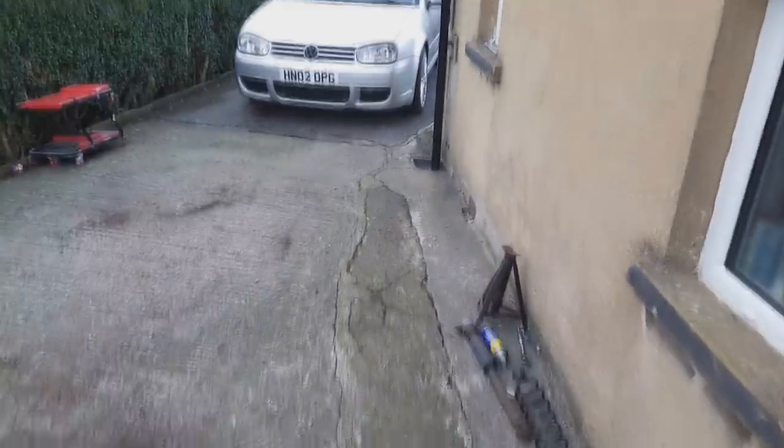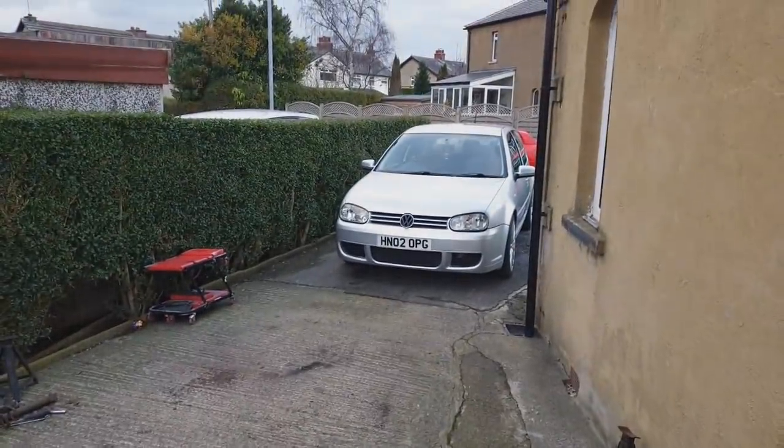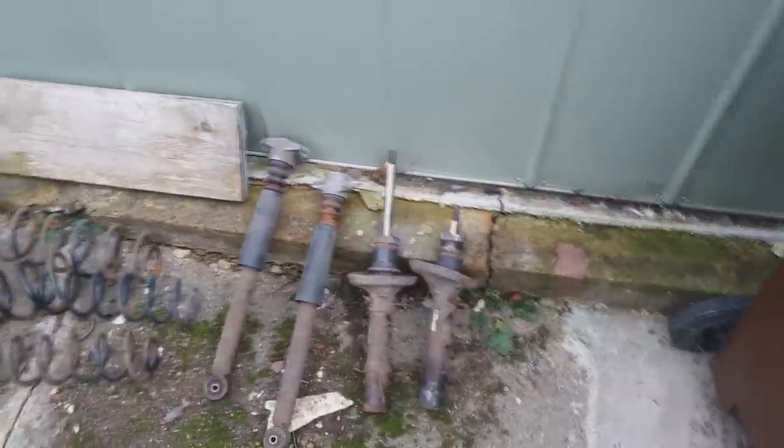I've done one rear side — now I'm naked and cold with the other side still to do. Here's the crap I took off. The rear dampers press and come out on their own — not too bad. The front damper though squashes quite easily with my hand and bounces back on its own — very soft. But this other front one is even worse — it just pulls out in my hand and squashes back with my fingers. Completely gone.